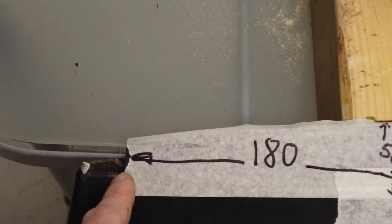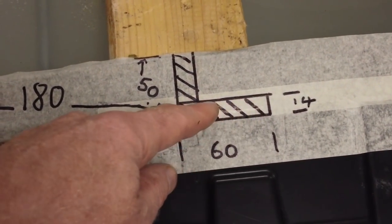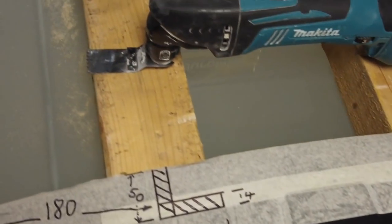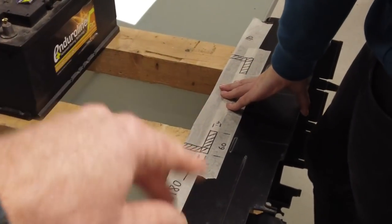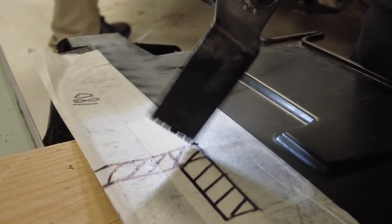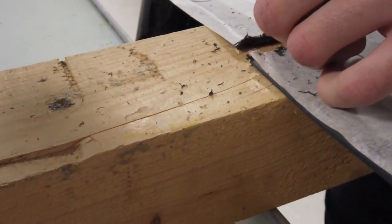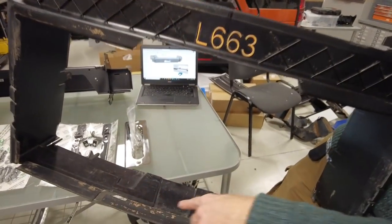You've got to draw a 14mm channel on an L-shape — it comes down 50mm and along 60mm. So: in from the side 180mm, down 50mm, along 60mm. We've got this setup with two bits of wood and a battery to counterbalance it so we can do a plunge cut. There we go — all cut out, all our little notches and the bottom bits done.